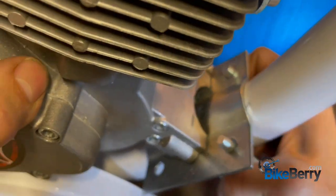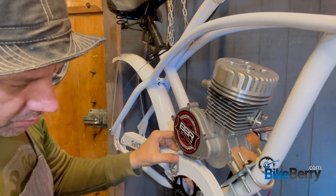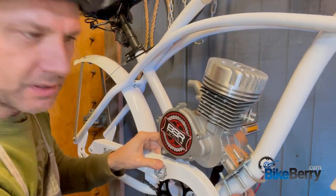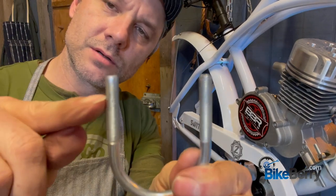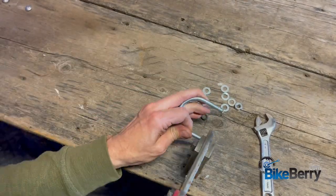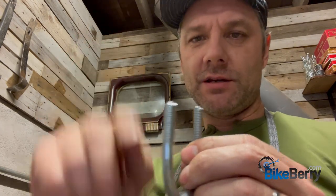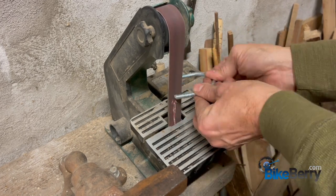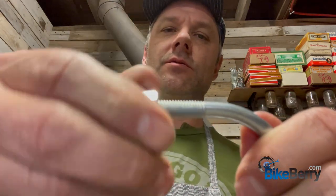Next we put in our front U-bolt. On the rear U-bolt, it's going to be a little long — it's going to go up and hit the casing of the engine. So we're going to do something about that. If you break it up into thirds, you're going to cut off about a third of the bolt. Of course that messes up the threads, so now we've got to fix them. One thing I probably should have done is put a nut on first to then undo and help fix the threads, but that's what we have sanders for. When you're sanding it, you always do like a 45-degree angle to it. See — screws right on. So now we put on the back of the bracket. See how much clearance there is now?